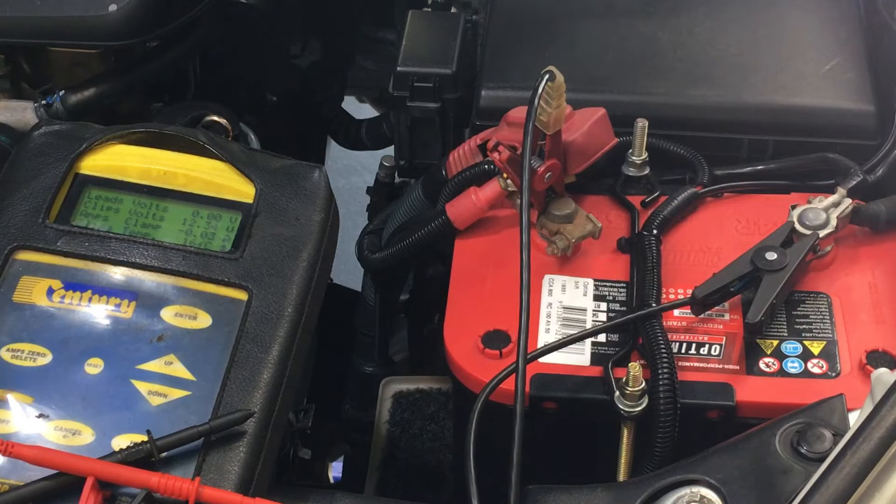If you've got a good battery that's charged, the voltage readings should be between 12.65 and 12.8 - that's generally a good battery. That's not to say a really good battery or one recently charged won't be a bit higher - 12.9 or 13. And a battery sitting there with doors open and the alternator not charging can have its voltage down as well, so don't think you need a new battery just because the voltage is down a little bit.